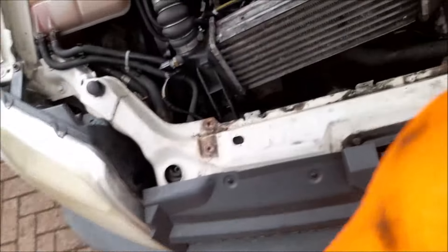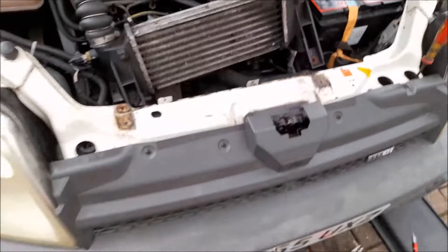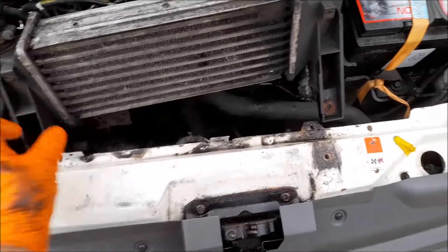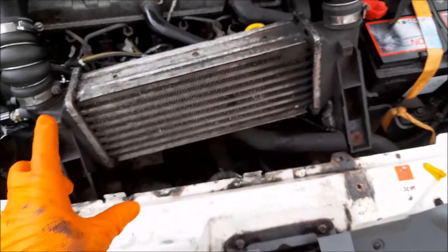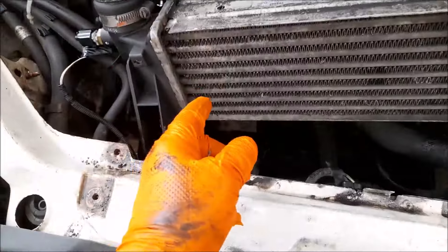Now guys, please - this is the end of the video. Can you please help me out here? This is an intercooler. It basically cools down the air going into the intake system from the turbo - it's like a radiator, but it's supposed to just have air in it to cool down the air as the car goes by. The ram scoop gets scooped in there, cools the air down, everybody's happy. Now this is going to be clogged up with oil and all sorts of carbon and shit. What would you soak that in to clean it out? Do you know of any product that will do that? Please drop a comment below, and I'll catch you guys on the next episode - thanks for watching.